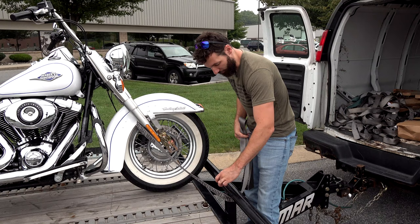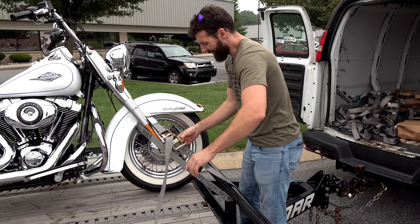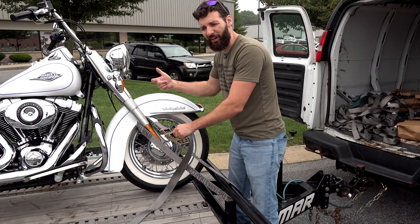If I put it on the other side of this beam, it's going to slide in and the bike's going to fall over. Another interesting thing about this strap is that it's an endless strap — there's no hook. The weakest part of any strap is going to be the hook, and if something happens and one of those hooks gets undone, it's going to lean the bike over to the other side, the other hook's going to pop undone also, and your bike's falling off on the highway.